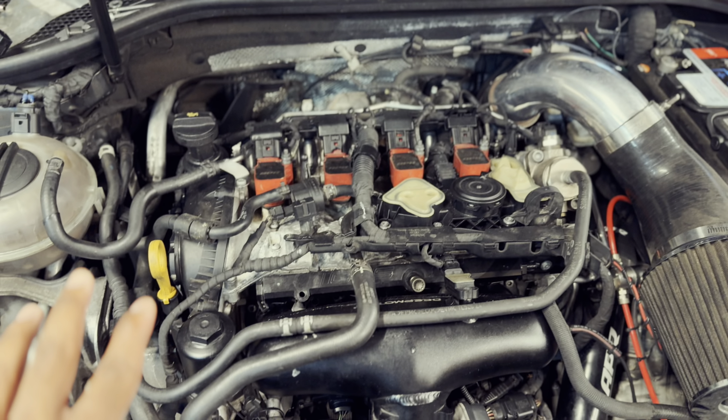Next up is the high pressure fuel pump, the brake vacuum pump, the engine coolant control valve, the combi valve, and a few other connections, and the secondary air injection hose that connects on the side of the head. Moving on from there, it's finally time to disassemble the timing chain side of the engine, with the timing chain cover, magnets, spool valve, cam bridge, and camshafts coming out last.